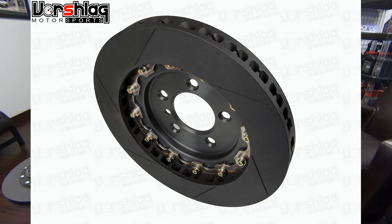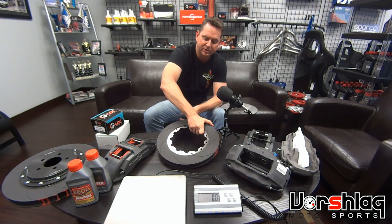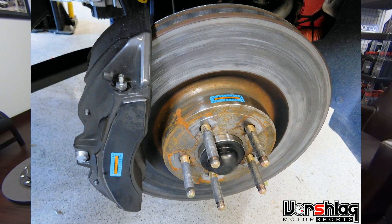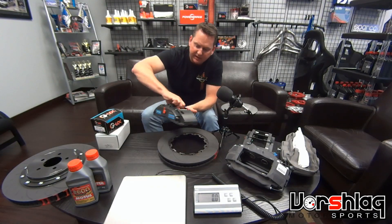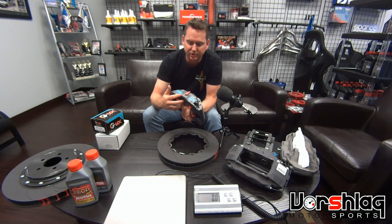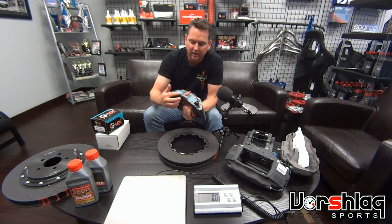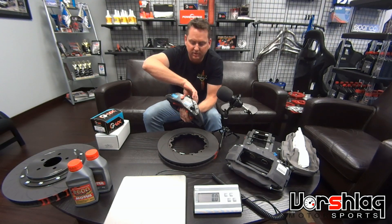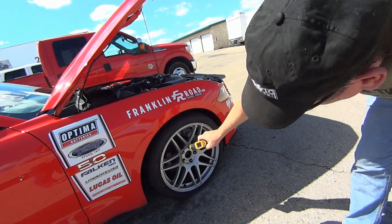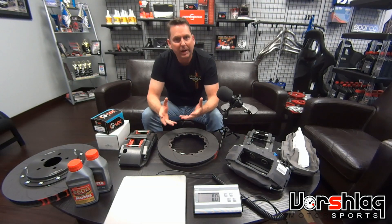They include the rotor paint. We understand rotor paint is more important for checking temperatures than an IR gun or a sticker. The temp stickers that they put on the calipers are more appropriate for checking fluid temperatures. We'll check that two different ways — with these one-time-use stickers, and sometimes we'll come to the pits without a cool-down and use an IR gun, shooting it right at the caliper and rotor face. That gives you data on whether you're in the right range.